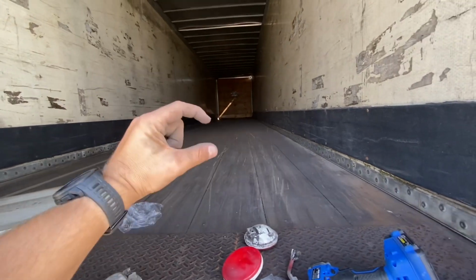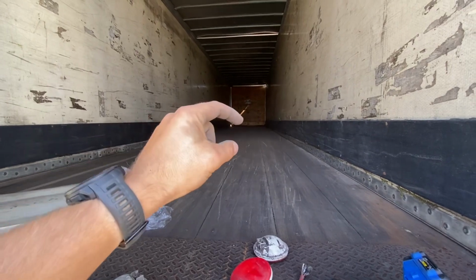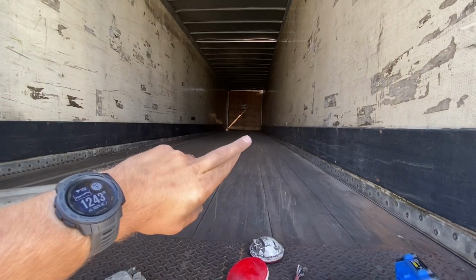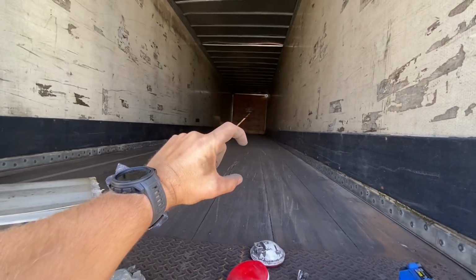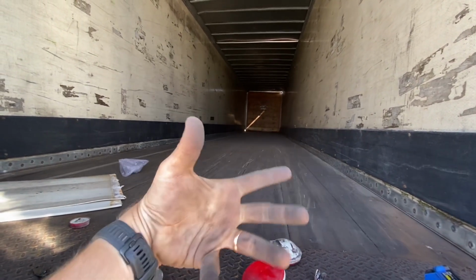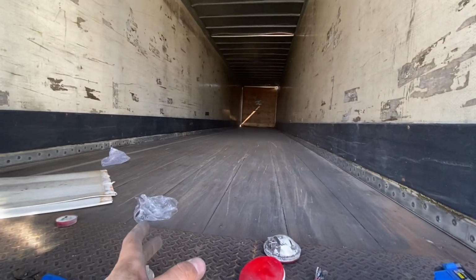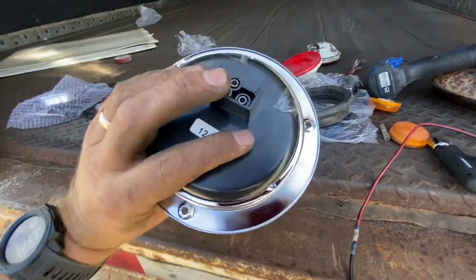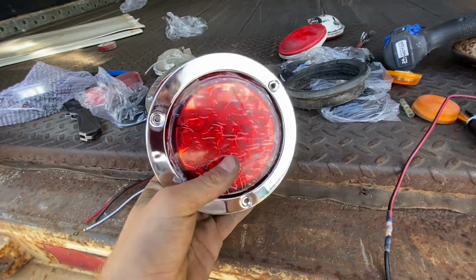And then I've got one down as the reverse light. So the Volvos come with just a little dim reverse light. And I cut the wires. It was just hot and ground, and put it in an LED bar, about that long. And so every time I put it in reverse, it illuminates everything behind me. So that way I don't have to hit the switch. I could just hit the switch, but I had extra time the other day, and Nilight stuff is so cheap and works so good. I'm like, hey, I'll do it. I was sitting on the dock. Maybe I'll go show you that in a second.